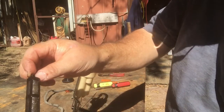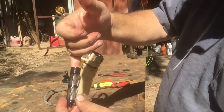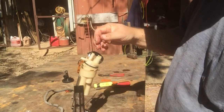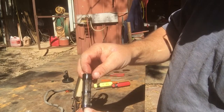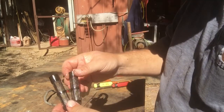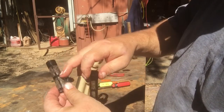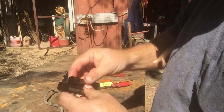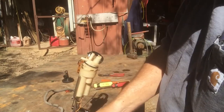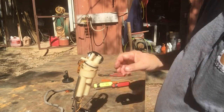The Hutch mod is basically doing away with some of this plumbing that goes bad and rerouting it with copper tubing for a more permanent fix. The biggest problem is these screens - they'll get clogged up. This is mostly trash, but when it gets sucked up in here, it builds up on the inside and can't go anywhere until it finally blocks you off. Once that happens, you'll start losing power or she might not even run. If you let her sit overnight she may pep back up, but once you pull the suction on it, it's going to clog the screens up again. Bacteria is most likely what I find as the problem, as opposed to the little bit of rust and trash.